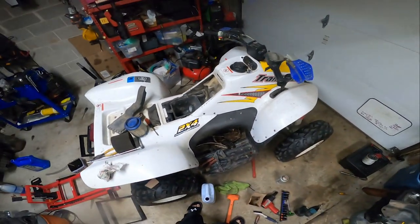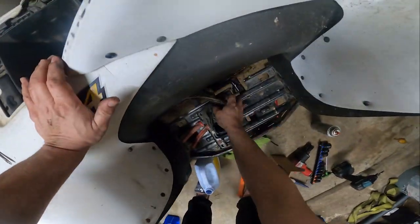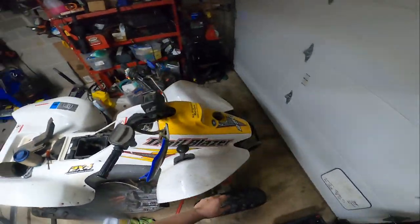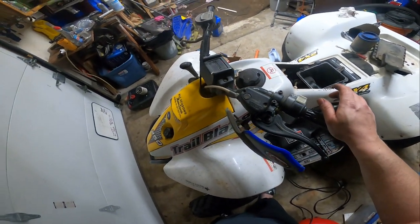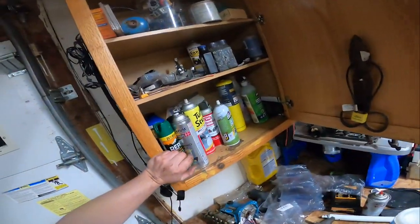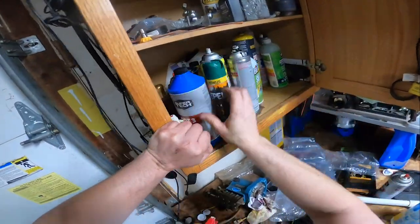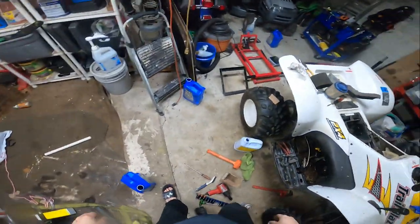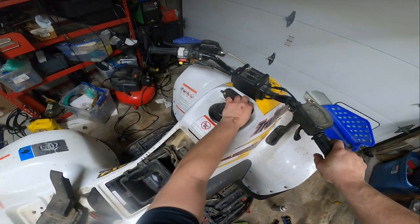The starter's definitely a lot easier to use than that guy, but we'll get some fluid for this. I think it's dot 3. Now look and see. I should definitely have some dot 3 around. Oh my luck, it's dot 4. Nope, whole bottle of dot 3 there. And I think maybe we'll just flush the whole kit and caboodle, and get that freshened up. And he said that this did run, so.